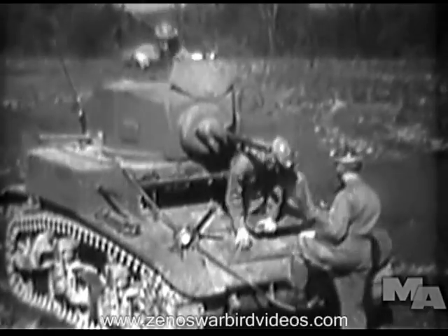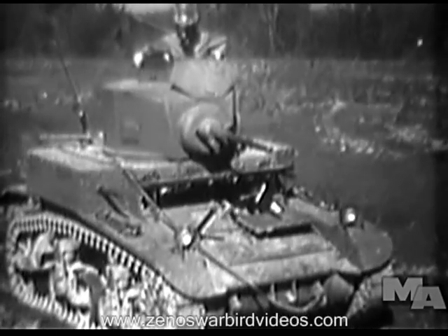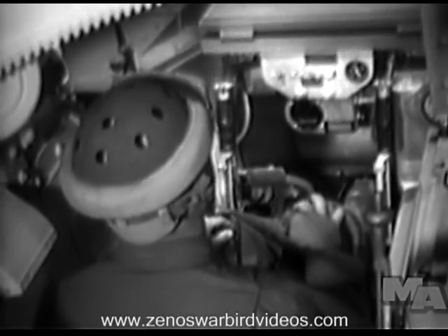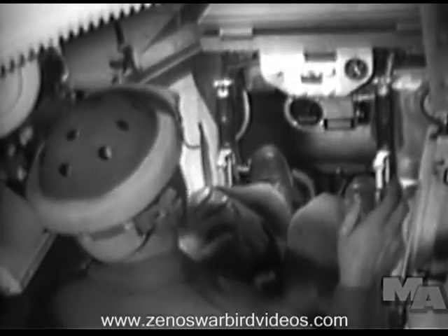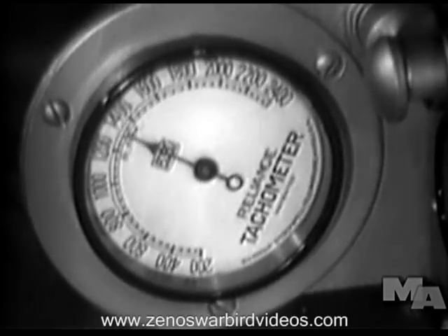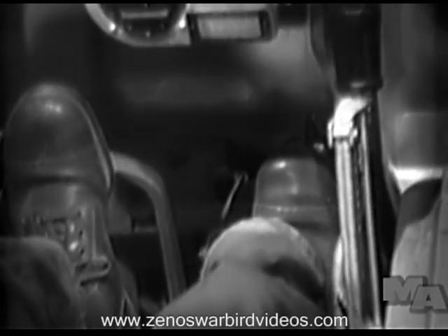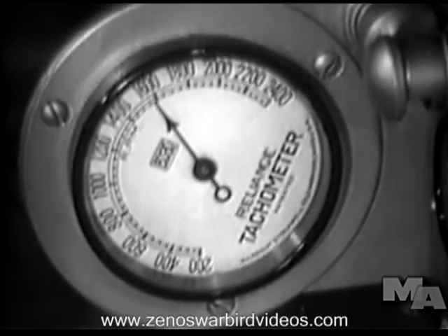Both medium and light tanks are driven in much the same way. To demonstrate the successive steps of tank driving, a skilled driver will operate this light tank. The accelerator pedal opens and closes the throttle, controlling the speed and power of the engine. Direct use of the accelerator, especially when shifting, is essential to good tank driving. To move the tank forward, the clutch pedal is depressed and the gear shift lever moved to first or second gear — both light and medium tanks are usually started in second gear. The engine is speeded up to about 1,400 RPM, the clutch gradually released, and as it engages, the accelerator is depressed to maintain engine speed. The engine speed should not be allowed to drop below 1,200 RPM or to exceed 1,800.